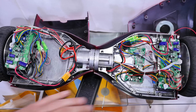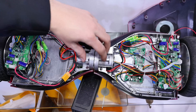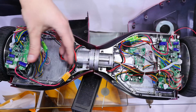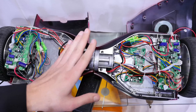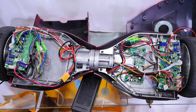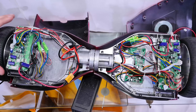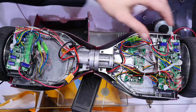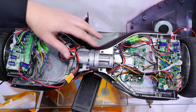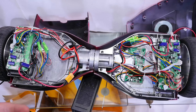There we go — they've removed the back cover. Here we have the cable which connects the left and the right part, and you can see it rotates, which allows you to steer into a curve. It has pretty massive cables inside because each motor has 350 watts, equaling 700 watts of total power in those small wheels. The whole chassis is made out of zinc-aluminum alloy, so it's really stable and durable.